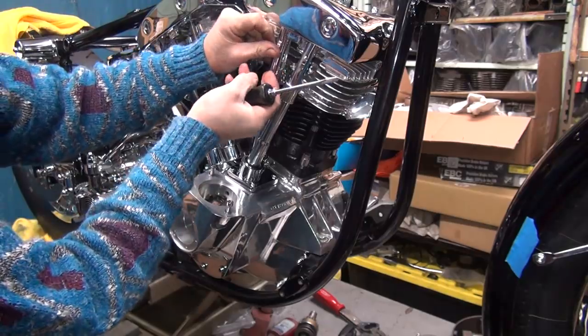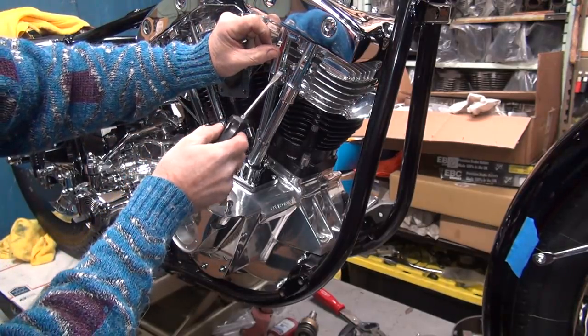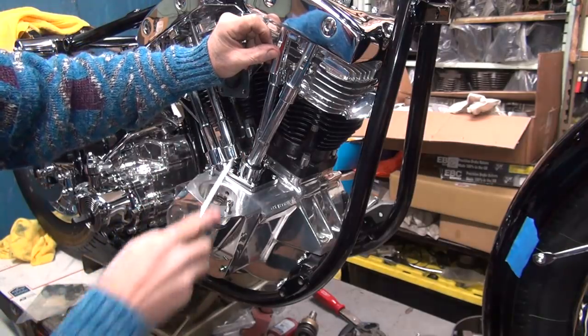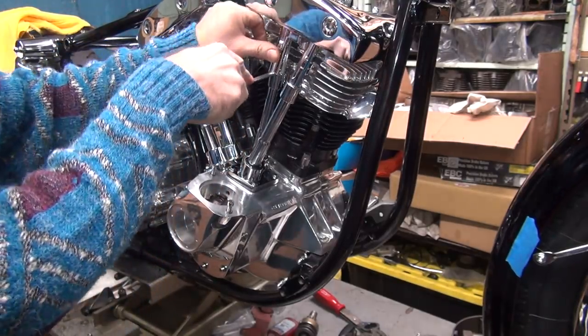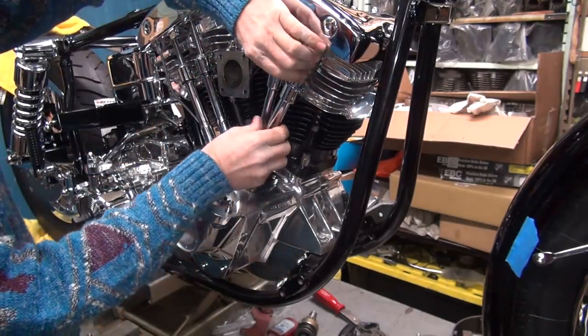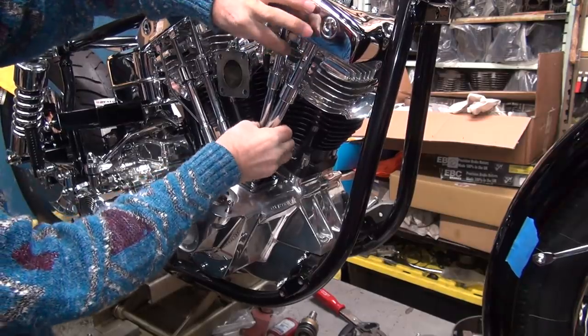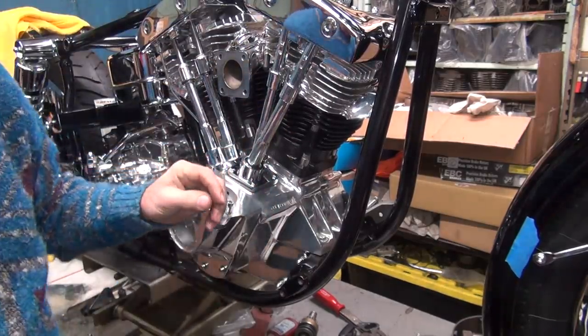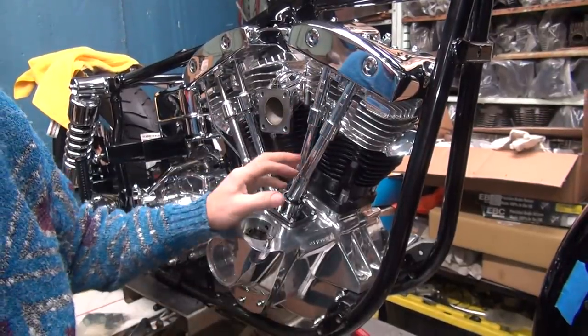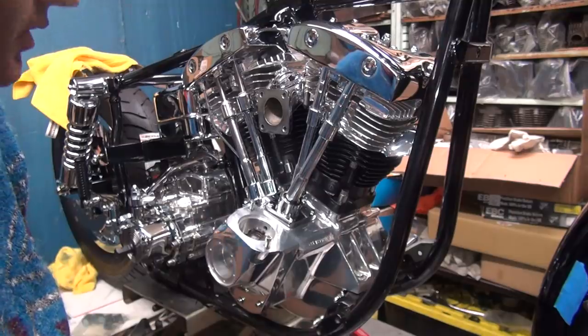This is our 3-inch clip. So you can see how much compression we get here on the intake side. We got about 3/8 inch of compression on this clip. Goes right in there like that. Now after you're in there, you rotate the top and bottom equally, and that will center the push rod up. The O-rings might get twisted or something in there. They might not be all the way in the hole. You twist them, that makes sure they're centered and everything works.